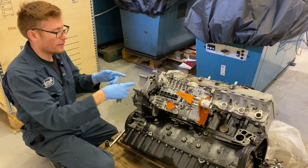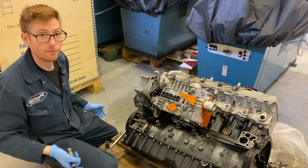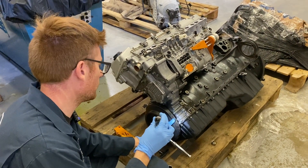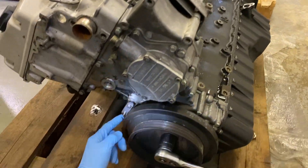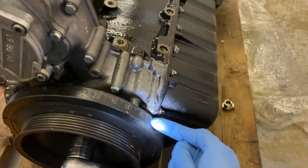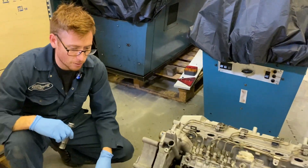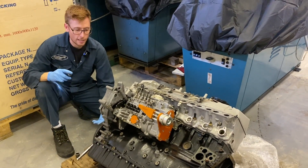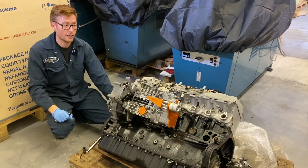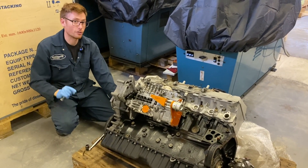This isn't a particularly accurate way of doing it, but it'll ballpark us — and this engine won't run right, that's why it's here, the customer sent it on a pallet. Let's have a look at what it's reading. Well, the timing markers are down here, so we know straight away there's something massively wrong. This has been completely wrongly timed. The main timing pointer's here, and we should have been reading 22 degrees before top dead centre — so it should have been here somewhere, just in front of that 20 mark. We can see it's massively out — probably about 100 degrees out of time, which would explain why this thing isn't running right. And don't think that if it's badly out of time it won't run — trust me, they will run. These things will even run with the injector pipes mixed up. The timing is crucial, but it will still run — don't be fooled. They do all sorts of strange things.